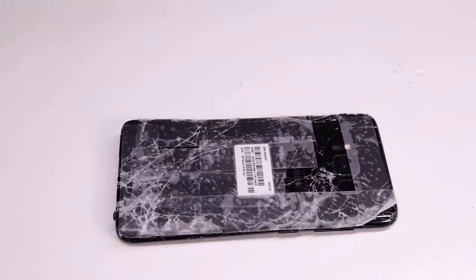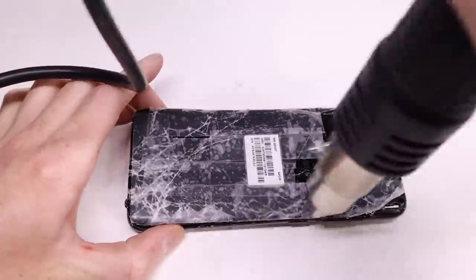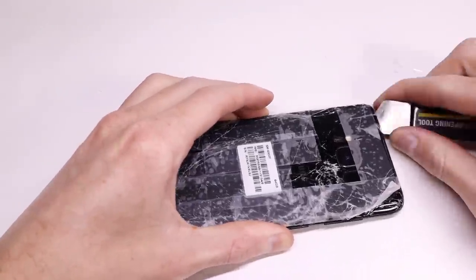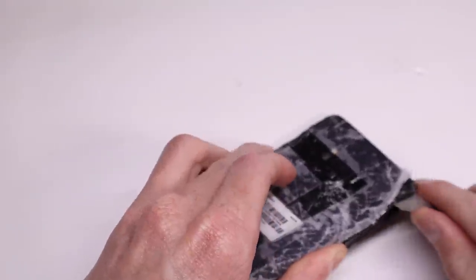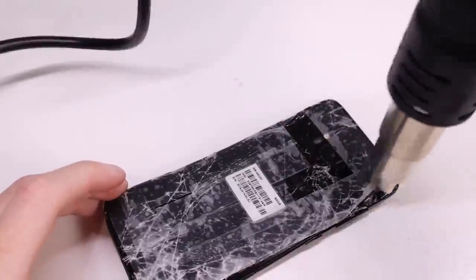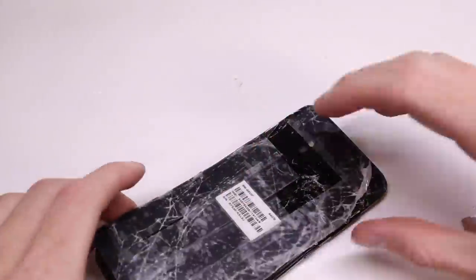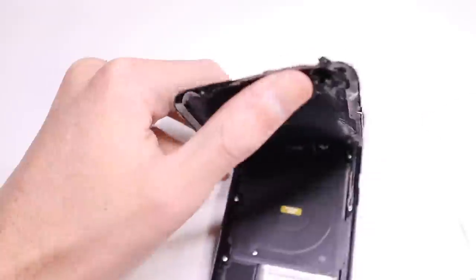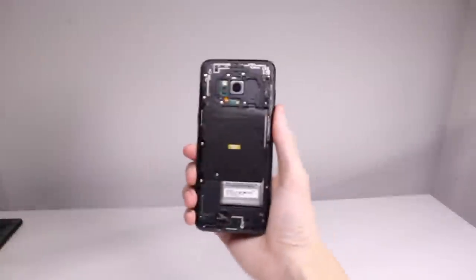Once you get the majority of the glue on the back lifted off, you'll start to be able to pry up the back panel. You need to be very careful because there's a ribbon cable connecting the fingerprint sensor to the motherboard — it's right next to the camera and very hard to see. When lifting up you need to be extra careful not to rip the back panel off tearing that cable. However, if you do rip that cable you can just replace the fingerprint reader and still retain the functionality, unlike Apple's iPhone where replacing the Touch ID sensor means you lose fingerprint functionality. You just get a spudger in there, unclip that connector, and then you can remove the back panel and you're inside the phone.